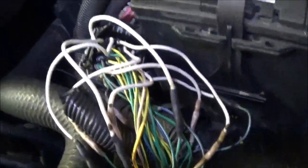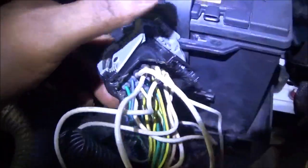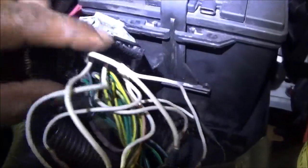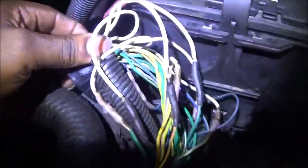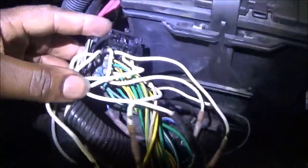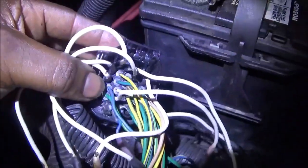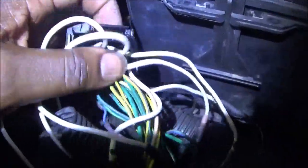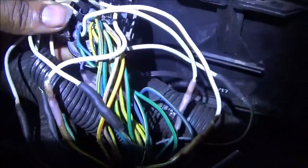I called to see if I could get a connector from a parts store, or a junkyard, or a newer one, and they never called me back to tell me what they could do. So I decided to take every single wire out and start soldering them and shrink-wrapping them myself. Everything that's all white are the ones I've done, and you can see a lot of other ones still to go. I think I started about 1:30 and it's almost 4:30 now — taking them apart, pulling them out, soldering them, putting them back together.